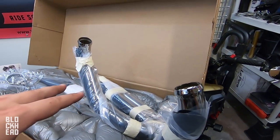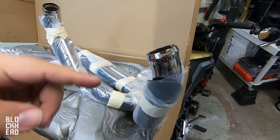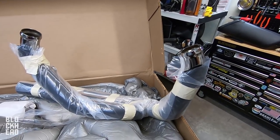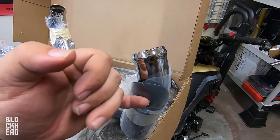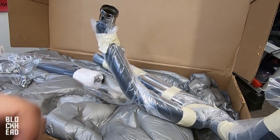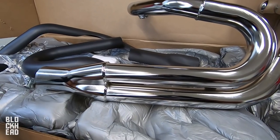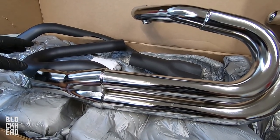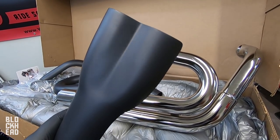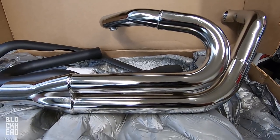At this point, whenever you start dealing with the new exhaust, go ahead and throw some gloves on. The oils from your skin get onto the pipes and after a few heat cycles it's going to discolor — start having that bluing effect, which some people like and some don't. It's good practice. So the main header pipe is unwrapped and the heat shields are not connected yet. I really love Bassani's finish on their products — their flat black is super nice and the quality of the actual pipe feels really nice.